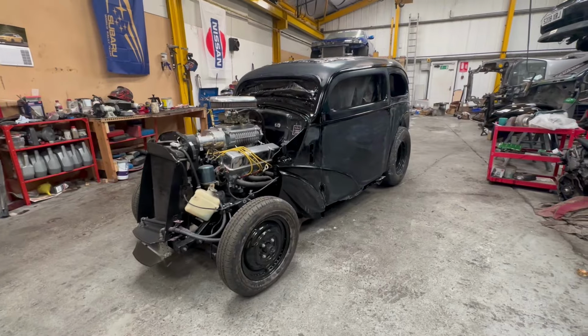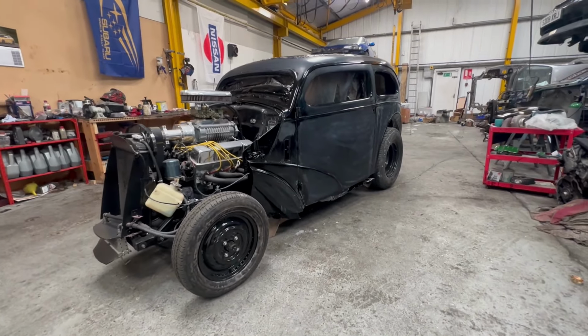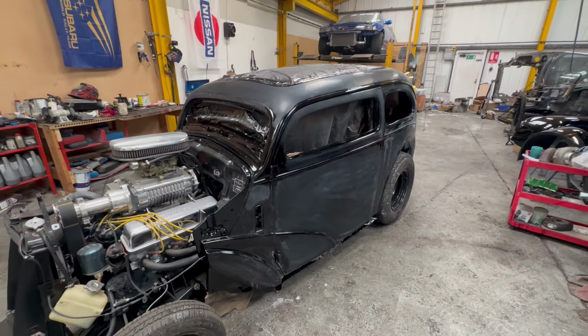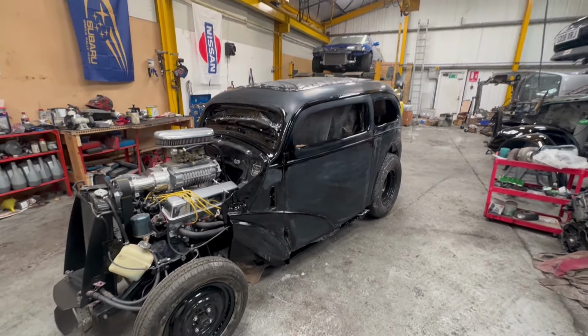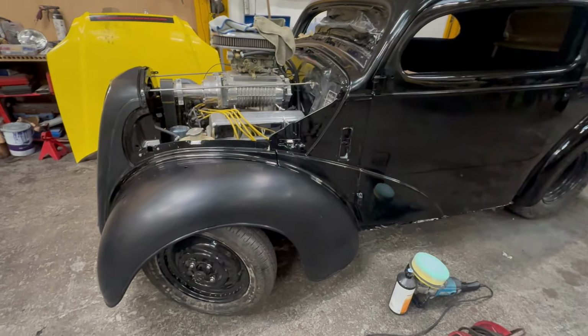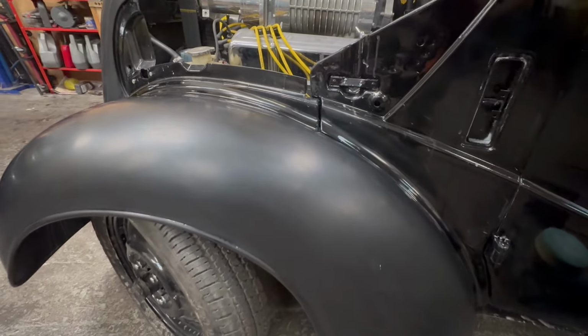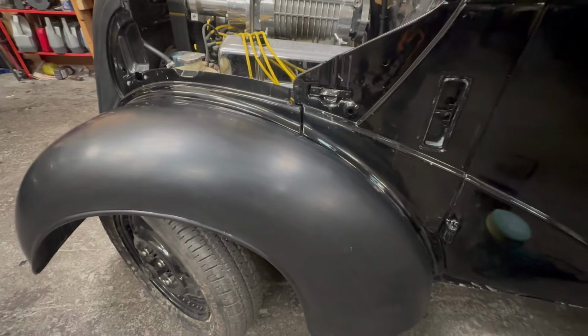It needed flattening and polishing, which is what this is about. That's always necessary to get the best result. It just puts all the paint to one level, and as you can see from this, before it's quite glossy, you sand it down to that finish and then you machine polish it back up with the cutting compound.